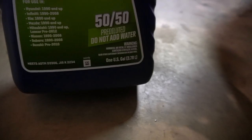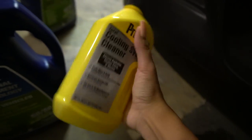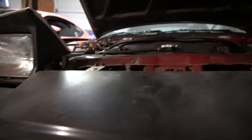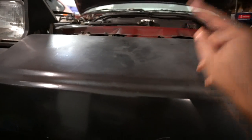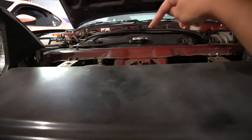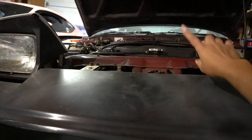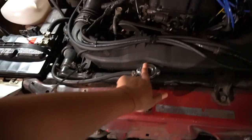The little 2.4 takes 7.1 liters, so I just got two. I also got this cooling system cleaner just to take out more gunk from whatever's in there, because it's obviously not clean. Just in case — do not do this while the car is hot. If you just drove it or anything, do not do this, because if you try to open your radiator cap, that thing could explode in your face with hot coolant. Touch the hose and see if it's cooled down; if it's not hot at all, then you can open it.